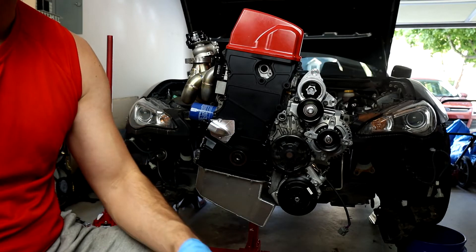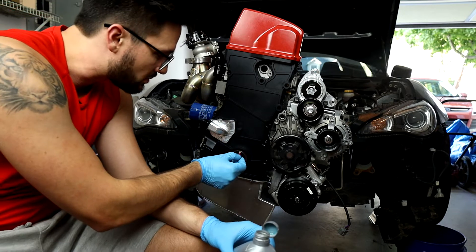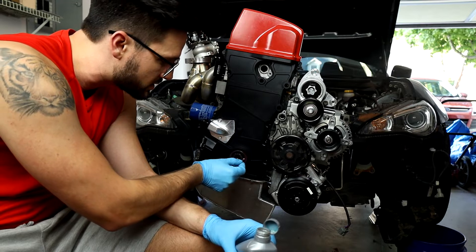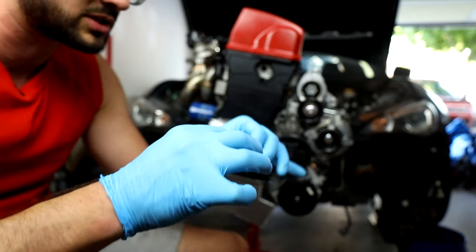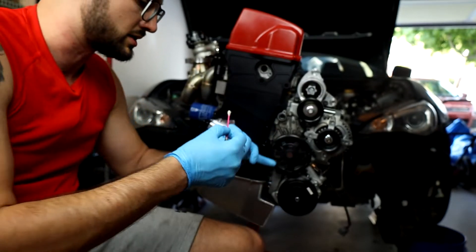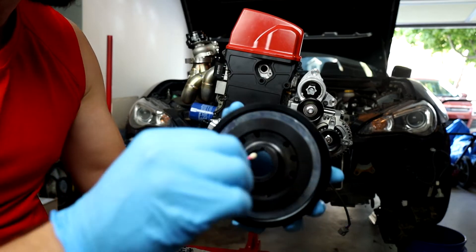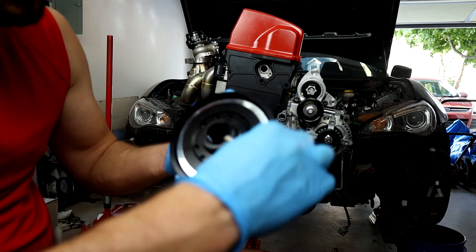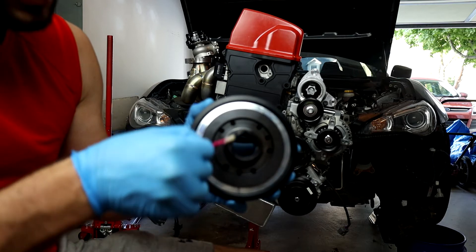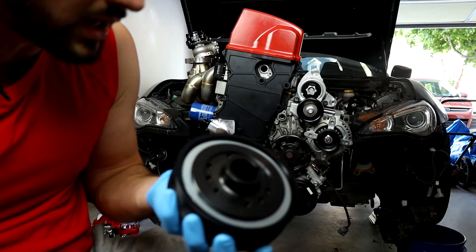To ensure a nice smooth installation, I'm going to take a little bit of fresh motor oil and use a Q-tip to apply some to the surface of the crankshaft, and a little bit on the inside as well for good measure. I'm also going to apply a little bit to the key to make sure it slides over the key nice and smooth, and apply some to the keyway. Then I'll also apply some oil to the inside of the super damper and to the back surface, to make sure we get nice smooth sliding everywhere. We just want a thin layer of oil - don't slop it on, just enough lubrication for the install.